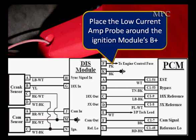We start by placing the low current probe around the B-plus wiring. This ignition module brings B-plus in on pin P via a pink wire — you can see our low amps probe connected around the wire. Keep in mind these probes are directional; if backwards, current flow goes down instead of up — simply reverse the probe. You could also put this on pin K, the black wire for ground, since all the current flow goes through that wire. Either will work, but you must start with a vehicle schematic so you know what you've got.